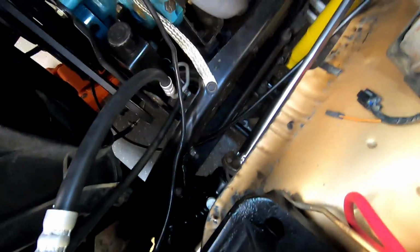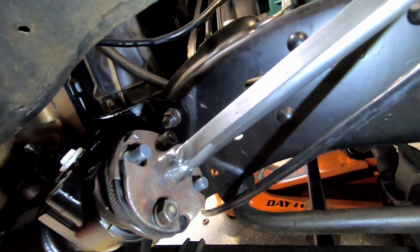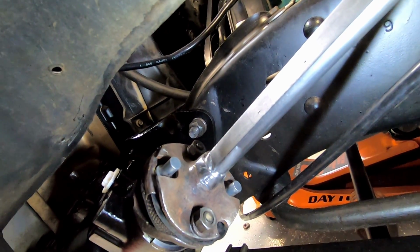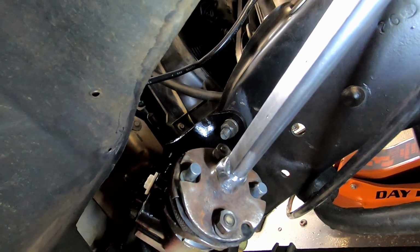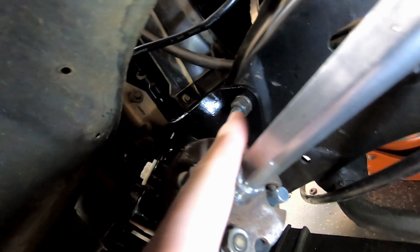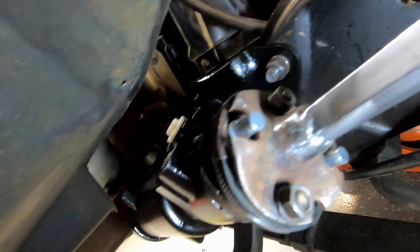And on my rag joint, that was kind of my last weld up we just talked about. I welded it with a pretty deep chamfer, and then I re-welded that, ground it, and then welded one more time where it needed it. It was kind of nice to use as the guide. You have a bolt that has a larger diameter and a smaller diameter, so that's probably 3/8 diameter, and that one's 5/16, so a little something special there.